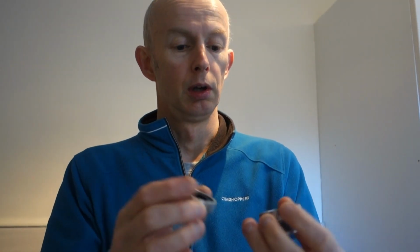I've got two new sets of bearings in two spare Shimano bottom bracket cups that I'll swap out. Because these are rubbish, they don't last 2 minutes. They're one of these 6805N bearings. Kinetic, I think they're called, and basically they're trash. So eventually I will put in either a Hambini bottom bracket because he's just made one for this sort of setup, or a Hope with proper 6805 bearings, which then I'll be able to put NTN in or whatever, and they will last a lot longer.